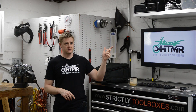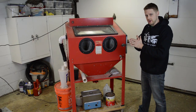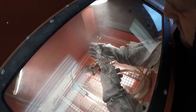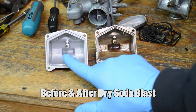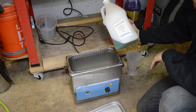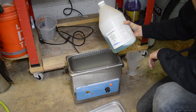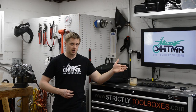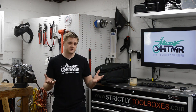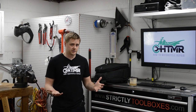So, a couple years ago, I came out with a video, best method to clean carburetors, and I used dry soda blast at 80 PSI. It's basically baking soda, but blasting grade. You blast the carburetors, and then you follow it up with cleaning in the ultrasonic tank. So even if the soda media gets in the carburetors, it will dissolve in water or in the ultrasonic, and you're left with a very fast process, and it looks pretty darn good.